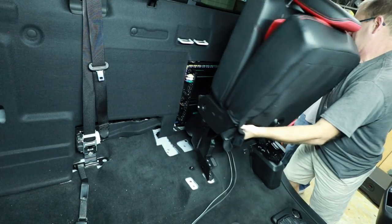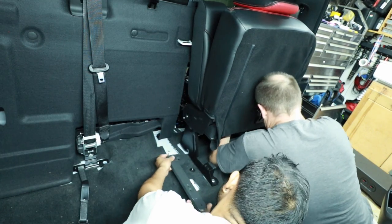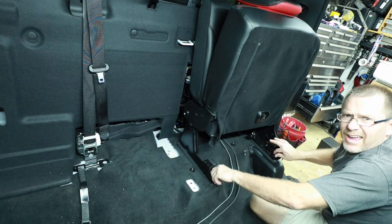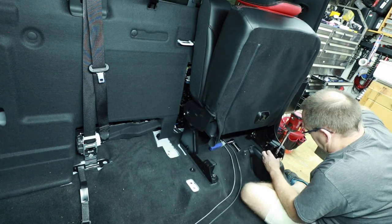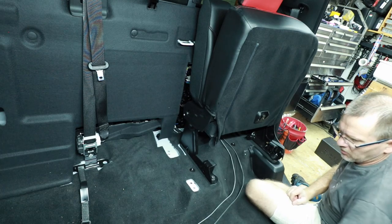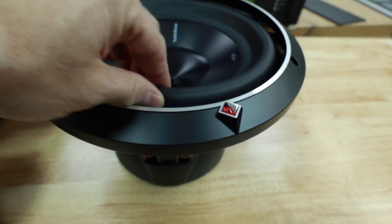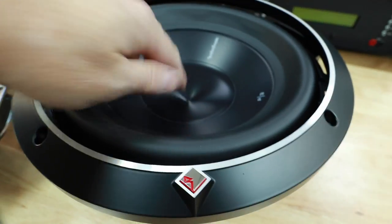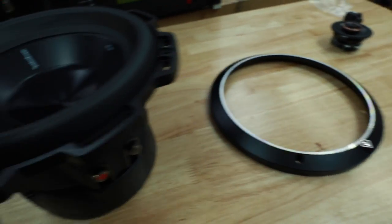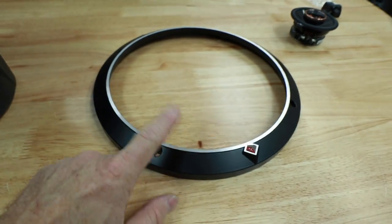I want to get the seat kind of put in place first, then lift it up and put these in. It comes with four new bolts for the front — make sure to hand-thread the bolts in first. The seat is firmly in place, moves up and down and gives us that extra inch of room for the subwoofer enclosure. For this install we're going to be using P3 10s — big nice thick rubber surround, aluminum cone, aluminum dust cap. It has a unique basket design; this is a dual-four, and we're going to run each one at two ohms to get us to one ohm mono.